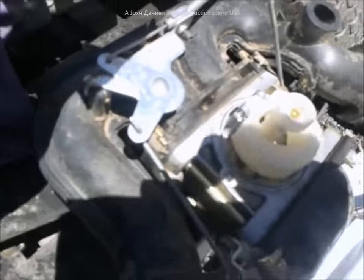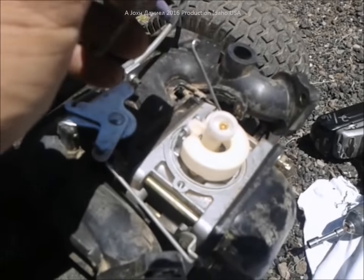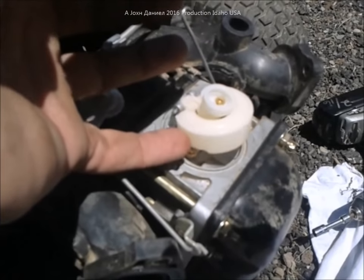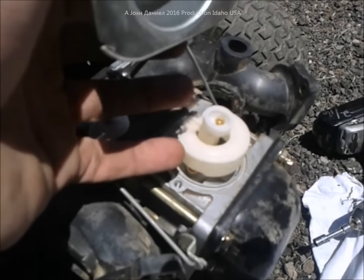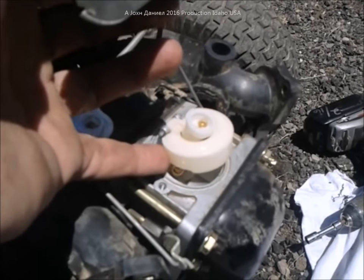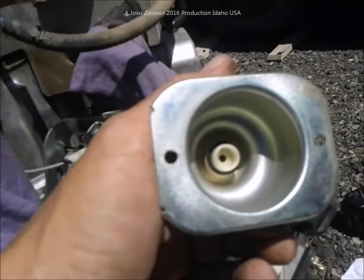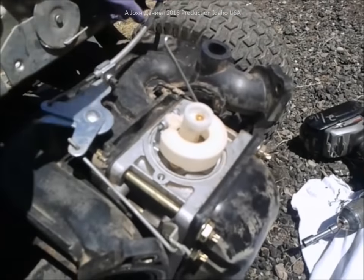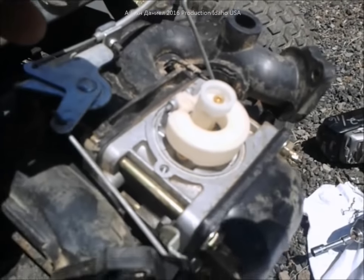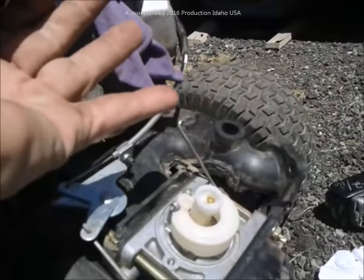As far as the needles and needle seats in these, they last a very long time. Before you do your O-rings, if you want to spray it out with carburetor cleaner, do it — but use some air behind it to make sure you dry it quickly so it doesn't affect your O-rings. A quick tip: hit it with a little WD-40 afterwards and then blow air on it again. That will preserve your O-rings, erase the carburetor cleaner effect, and neutralize it. A little WD-40 goes a long way on cleaning these off after you've gotten your varnish cleaned off of your carburetor.